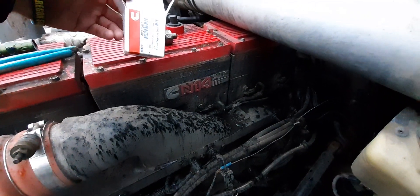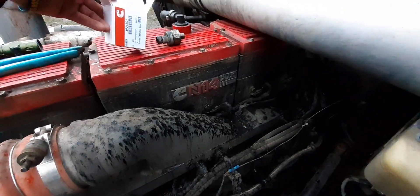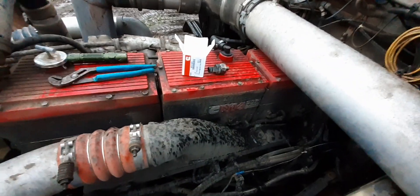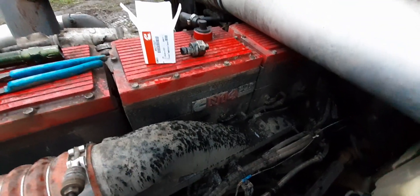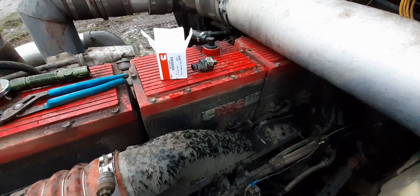I have a chat about N14s today. Got to run something past you real quick. This truck's been giving me trouble here in the last few months. Haven't been using it a whole lot. It's been popping and snorting, kind of a stumbling type thing when you start it up in the morning.